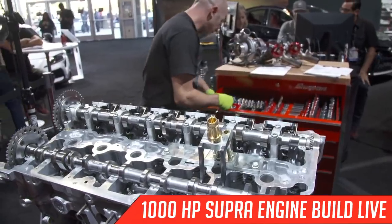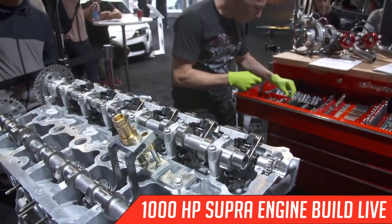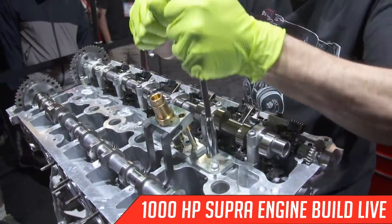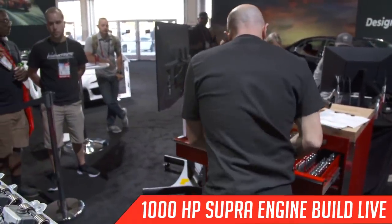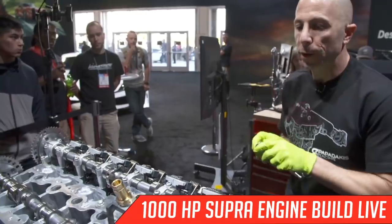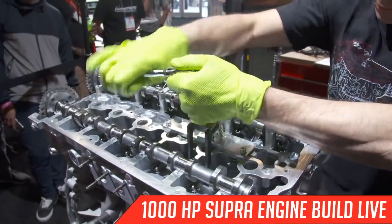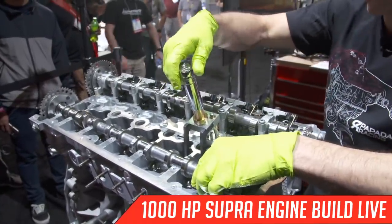What we're gonna do is take that tool, bolt it in. Once I get the 10mm socket. It's always the 10mm you gotta find, right? It's missing. So no problem, I got 10mm. Tighten these down. Just snug. And then grab another ratchet, which I believe is a 17. Okay, and then watch this. As you start tightening down, it starts pushing down the rocker arm and opening up the valve, and then it allows the cam to sit into the groove there, just like that.